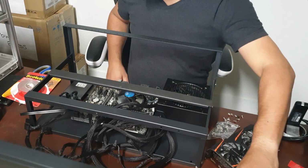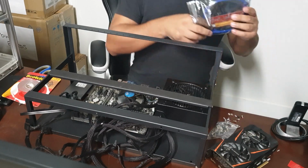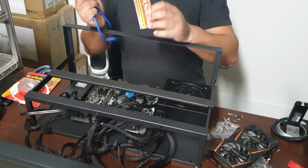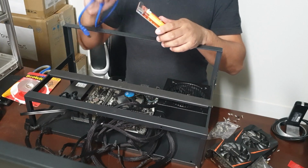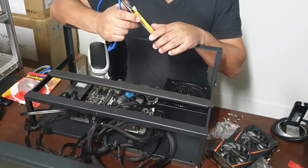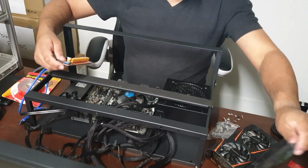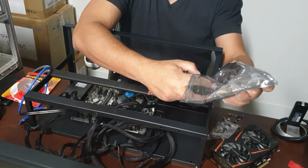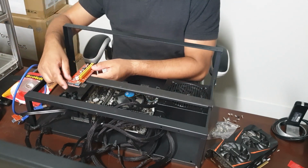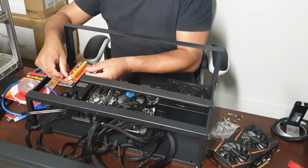So the next thing we need to do is the GPU riser. So again, these will be linked in the description. You can buy these on eBay or Amazon or wherever you want to get them from. They're relatively inexpensive. You can get the SATA versions or the Molex versions. I personally prefer the SATA version. It's just kind of easier to power. So that's just going to sit right there like that. You can obviously place it wherever you like. I'm just going to put one on the end, just like that.